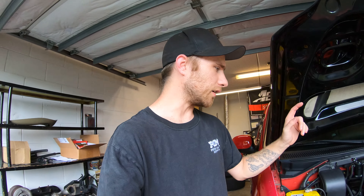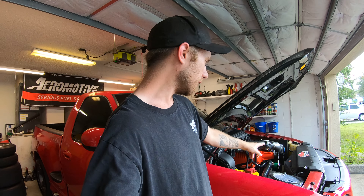I mean everywhere. After doing a little bit of research and some trial and error — process of elimination, whatever you want to call it — we found out it is coming from the blower snout. Basically we are somehow getting pressure into that front gearbox on the blower and it blew the seal out and is blowing oil all over the engine bay.